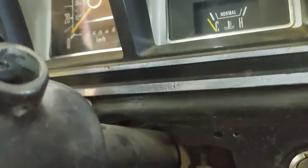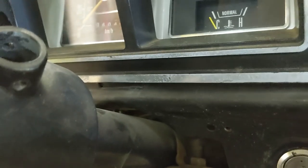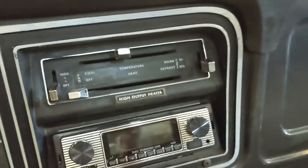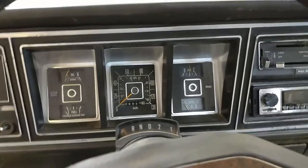Once the dash is back together — if you're like me and want to do this a couple of times over — don't forget the little tab right here that hooks to this black plastic piece. You kind of flip it up and get it behind this piece. If you want to do it once, remember to flip that over. Also be careful around the screw holes — this is very old plastic, so don't crank on the screws too hard because you'll poke them right through. There's one on this side that got poked through over the years and it breaks the back of the plastic away.